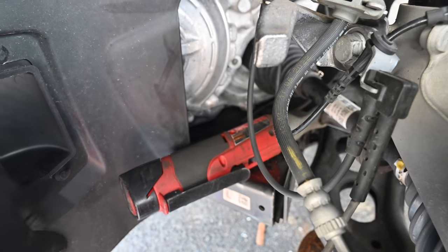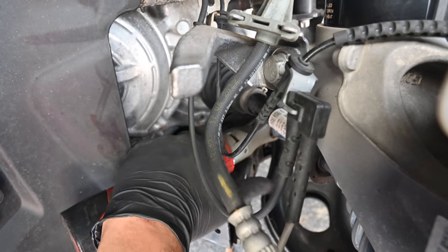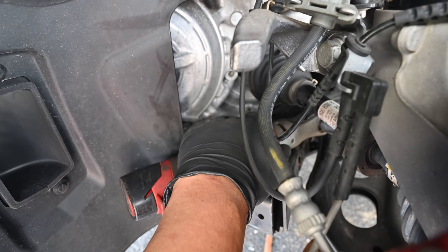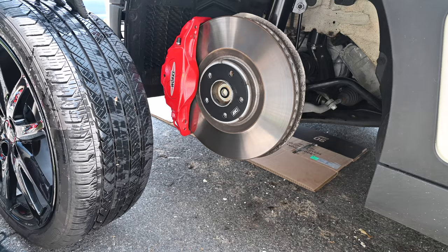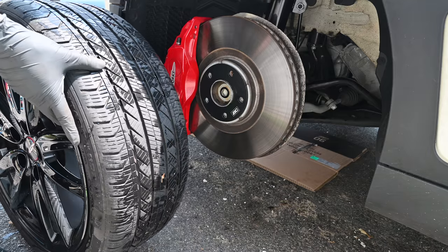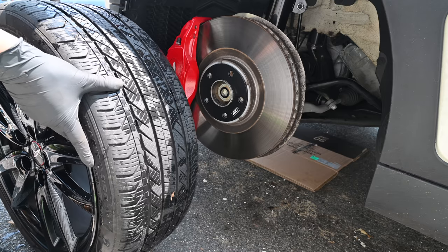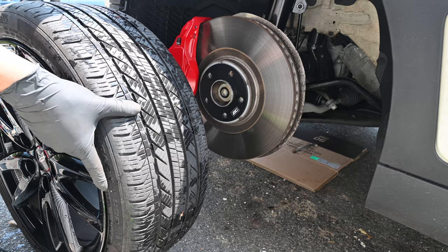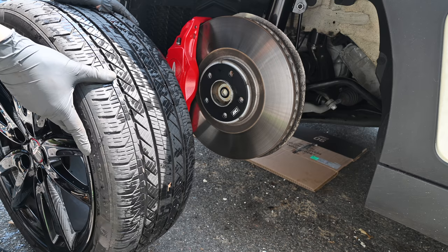Fish it through here, the electric ratchet just slightly under the axle. I'll finish that off with a wrench and Allen key. Just want to call out that the BCs do come with a very small 5mm spacer because things get a little close without it. With the 18s, it's definitely touching. If you have a non-JCW with 17s, I don't know if it's as close, but I'm assuming it is - that's why they include the spacers. It was a nice little touch because I did want to get spacers for the car anyway.